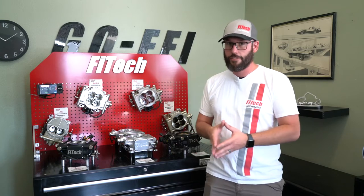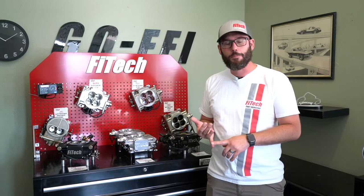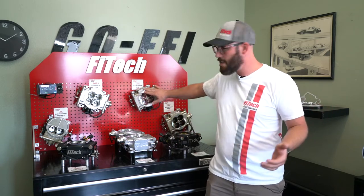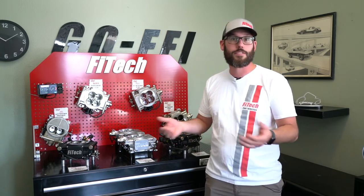With all the fuel delivery options available, going back to our reference of a '72 Chevy truck with a ZZ4 crate motor — about 350 horsepower — our recommended setup would be the Go Street EFI that'll support up to 400 horsepower, an EFI replacement gas tank which is available for a '72 C10, and then you would also need a set of fuel lines to run from the gas tank up to the EFI and back. We have fuel line delivery options available in 20-foot and 40-foot options in black and in a traditional stainless steel finish.